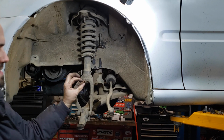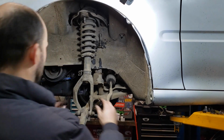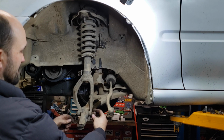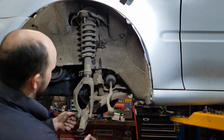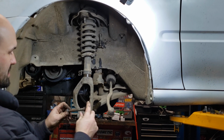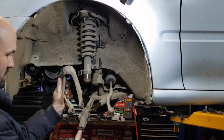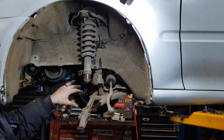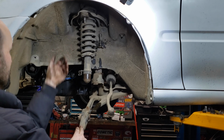See there, that's the bolt on the back. It basically separates the fork from the shock. There's a 17 millimeter bolt that goes through the bottom of the fork here. This one was already loose, so I have a 17 millimeter nut and a 17 millimeter head on the bolt. And the fork comes off, and now it becomes easier to work with. Now if the axle was still in there, you can still take the fork off. It makes it a lot easier than trying to deal with the complete shock.